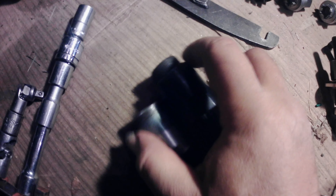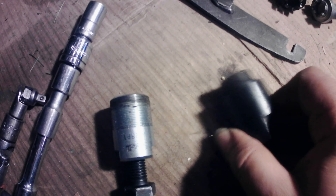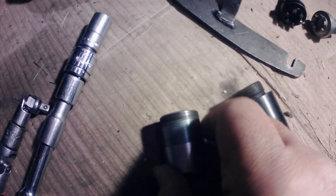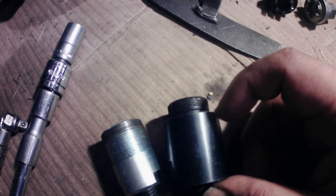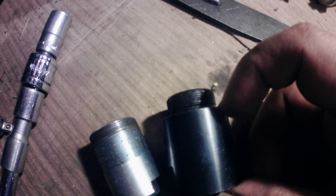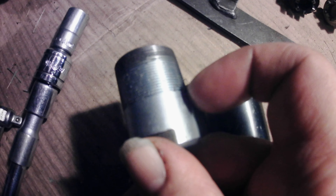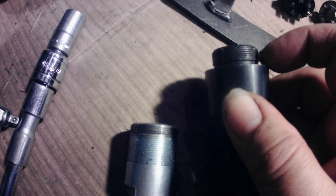Here's a simple little video on a flywheel puller. These are both flywheel pullers — this is the small frame, and this is a regular. Do you see how this one has a short thread and then a flat block right here? Try to get the ones that are just fully threaded all the way to the back. This one has like a stop to it.